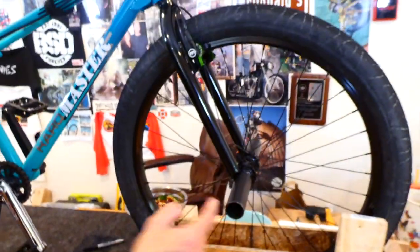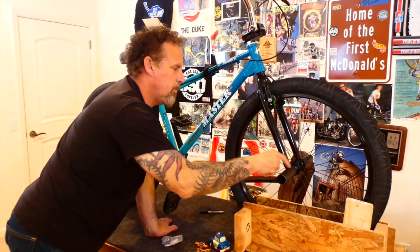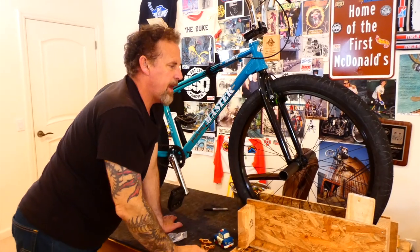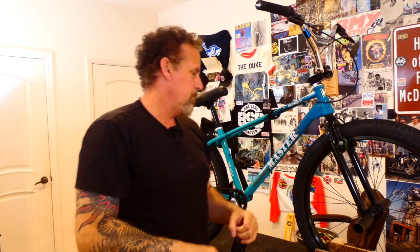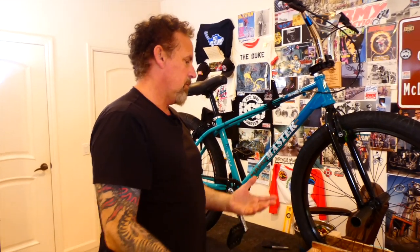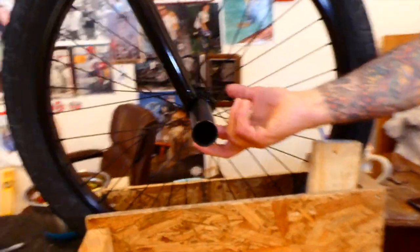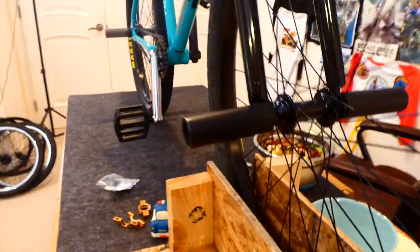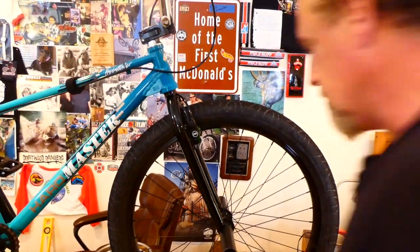So there's two bolts. They're actual hardened bolts that go in through the peg into the center of that axle. In order for that axle to bend, it's got to stretch all those threads. So it just works. It works really good. If you look at them from the front, they look like they're bent down, but they're not. I think it's that there's slack on the inside of this peg, and that the dropouts move. But as soon as I take those off, the axle is straight.